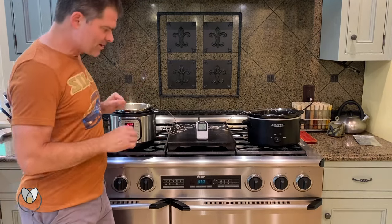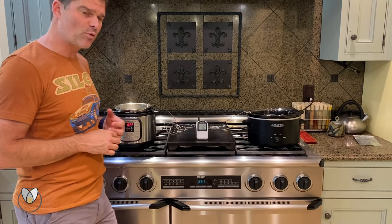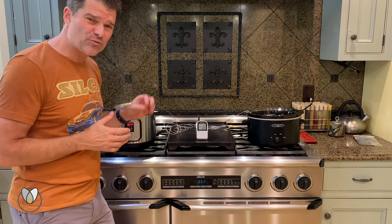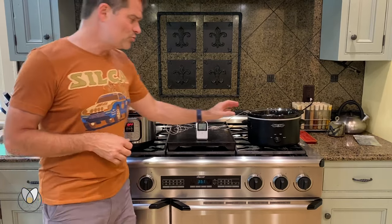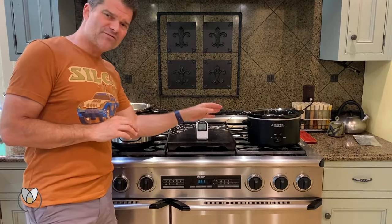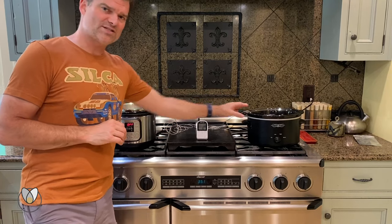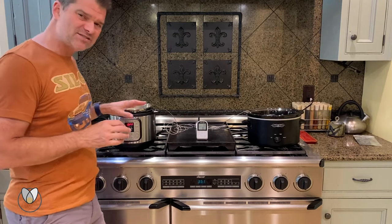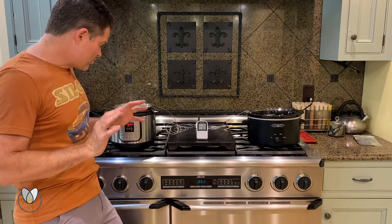All of this — about eight minutes to get to 180 degrees for three cups of water versus 73 for the crock pot. That's why if you're out there hot melt waxing chains using a crock pot, it takes about 45 minutes to an hour to melt the wax. Here, you're going to melt the wax in something on the order of 7 to 10 minutes, depending on how full it is.